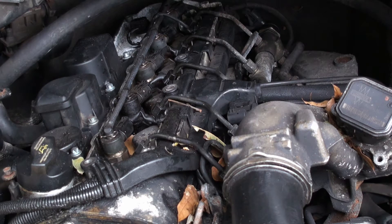Now if you're dealing with 2007 to 2009 Sprinters and anything above, you cannot just take one from a 2007 and stick it in a 2008 or 2009 — you can't. Those are programmed to work specifically in that cylinder. These fuel injectors have numbers on the top, and they use those numbers to program them with a computer for that specific cylinder. If your vehicle is not starting, this could be why — it needs to be reprogrammed, so you'll need to take it to a dealer or someone who has the ability to reprogram them with a computer.